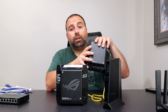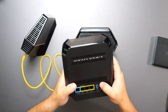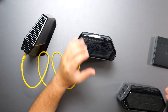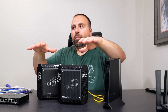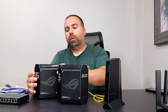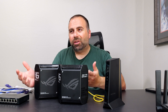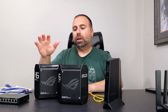Inside the app, it will ask you to plug in the secondary one and says to plug it within one to three meters away. You just power on the second one — plug it in, power it on — and wait like a minute or two, and it will automatically connect, increasing your Wi-Fi coverage. However, once the second one is set up and you see it in the app, you're going to disconnect it because you don't want them in the same room.